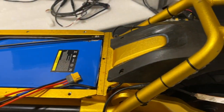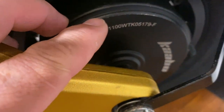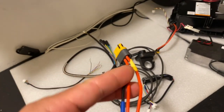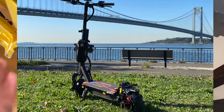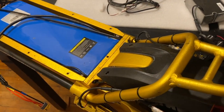The model we're going to be using is the Wolf Warrior X Pro — it's a 60 volt, 10 inch, 1100 watt motor from Kaabo. I already did the wiring attachments for the MR60 connector. Now, this motor's wiring is on the right side, and so is the disc. Meanwhile, the 9BotMax has its wiring on the left side, so pay attention — the wiring I'm going to be doing is as if this motor was facing the other side.